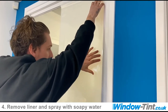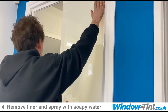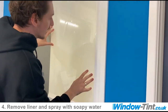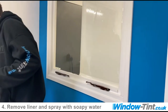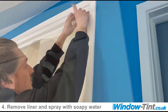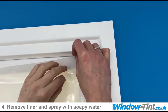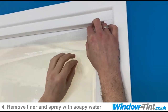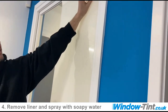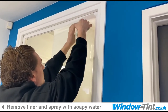We cut it a little bit over to make sure that there is overhang at the top and at the bottom of the window. This is so that we have a corner or an edge that we can work with to be able to remove the backing film. We tend to advise getting two little parts of tape, attaching them to one of the top corners, then peeling the two bits of tape away — this will start removing the backing film for you. Another little tip: get your spray bottle and start spraying the film as soon as you remove the backing to prevent any contamination sticking.